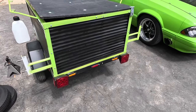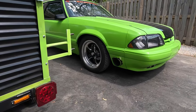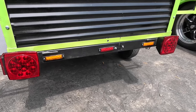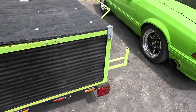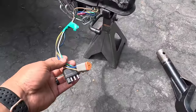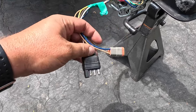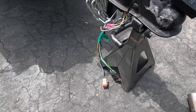As far as lighting, I would definitely recommend having a lot of it. Last day before we loaded up and go, I realized Fox Body Mustangs have separate turn signals from their stoplights, so when I wired in the standard 4-pin or 5-pin trailer connector, basically we had no turn signals. I had to add these two separate ones — right and left turn. Essentially the normal trailer plug does your stop and running lights, and these other two are directly tied to just the turn signals. In the future we'll probably switch to a 7-pin connector to make it easier.